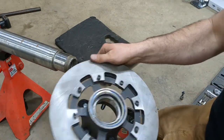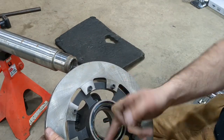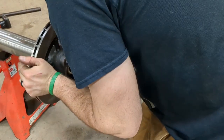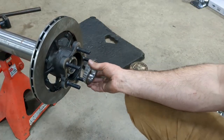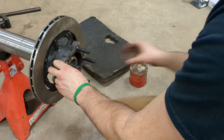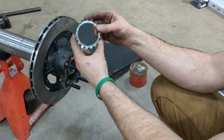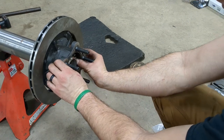Our first step before we get crazy with this is to put a little grease on our seal so that we don't risk tearing our brand new seal on the axle housing. We're going to slide this up over the housing — right there is the seal fighting it as it goes up into place. The next step is to take our bearing and install that. The races were already installed on these so we didn't have to worry about tapping those in. Then we've got to put our locking washer in — this is going to go in with the inner tang facing the pumpkin, and the outers can be folded over to lock the retaining nut in.